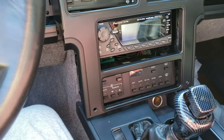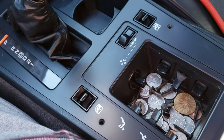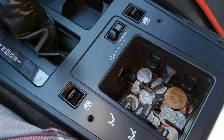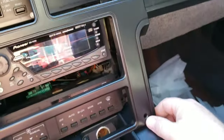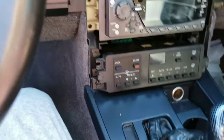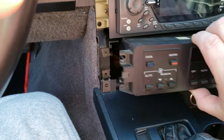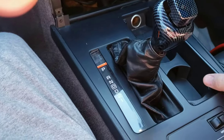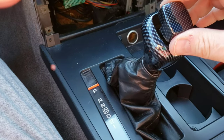It's pretty easy but you've got to be very careful and organized. I use this center console area to put all my screws so I know everything is in there. Basically you're going to unscrew and gently remove this unit — this is your one-piece unit. You'll have your information center, your stereo, and this. You need to access the screws to take out the bottom screw here. For purposes of the video I'm going to move this out to show you.